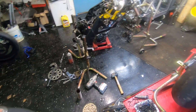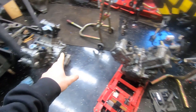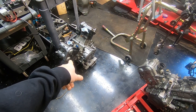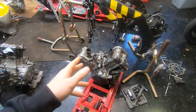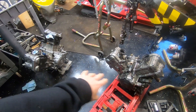I did this a couple days ago and I've done nothing since — I've been super lazy, I'm sorry. What we need to do is get the A motor back in. I'm going to plane the head, just because it blew a head gasket, so I'm going to try to see if I can get it a little flatter. And then I'm going to inspect the slipper clutch, move the slipper clutch over, flywheel over.